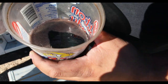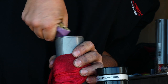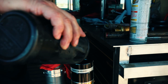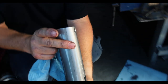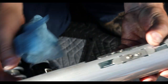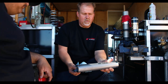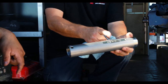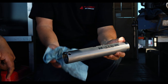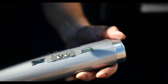You can see the viscosity difference in it. I believe there is no hole here and no hole here, so your first hole appears to be this hole. They bend out of the way and allow oil to bypass — four ports basically. As the piston shoves up through there, the oil can bypass. But once it crosses past all these holes, you have a bump zone where you have full valving. Then you start to slow down, and if there's a bleed up here, you're slowing down and actually lose force.